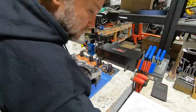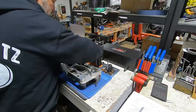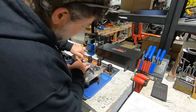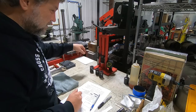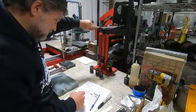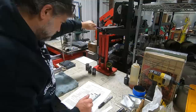It's not unusual to have as much as about a 10% variance in seat pressure at a given installed height, but we want to verify these installed heights as well to see exactly where we're at. I'm going to pop the valves in — rear exhaust is one inch, 760. Moving to the rear intake — I want to use the actual retainer because there could be some wear. These are titanium retainers so I wouldn't expect to see very much wear on these, but we need to account for that. That's one inch 760. The front intake is one inch 755. And that's one inch 750 on the next one. This is the rear exhaust — installed height at one inch 760.